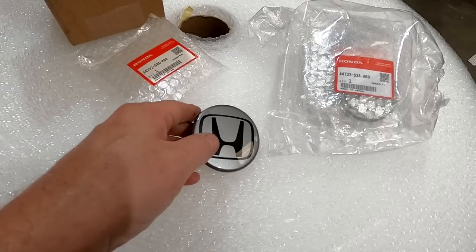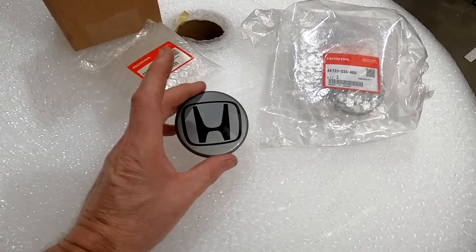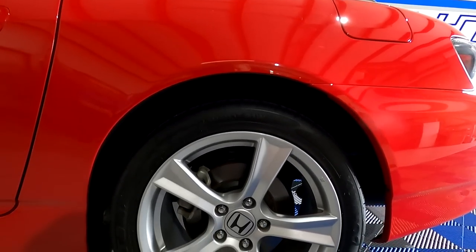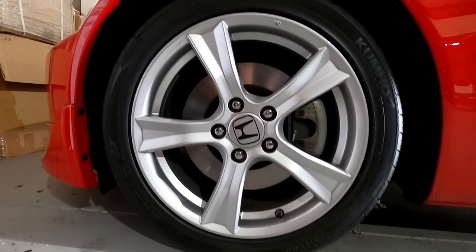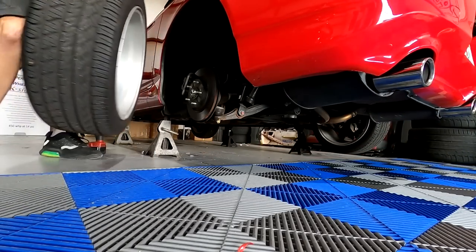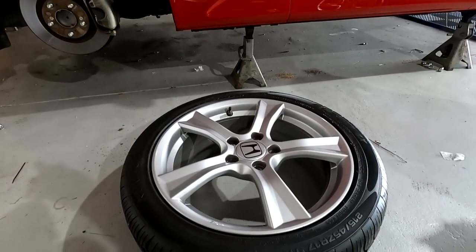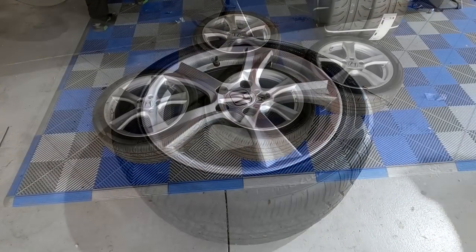Rather than take the wheels all over the place - take them to Dave, take the tires off, take them to Austin to blast them, take them to Superior to get them painted, take them back to Dave - that's a lot of trips and a lot of chances of something going wrong. So what I'm going to do is take these to Glen's in Tampa. He's like a one-stop shop; they can paint, chrome, powder coat, whatever. They should be able to match this perfectly. We'll take the wheels and tires, the new tires, drop them off and say call me when it's done. I'll show you the whole process while the wheels get done, refinish the calipers, put our brake package on, do the coilovers - do it all in one go. The tires are 10 millimeters wider, which should give it a little more aggressive look. I'm going to drop it between 10 and 20 millimeters so it gives it the look but doesn't lose the function.